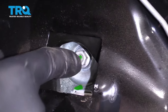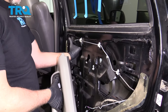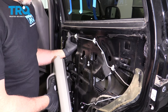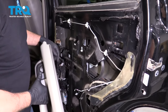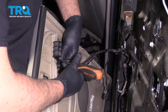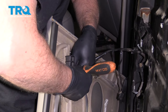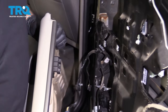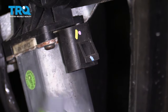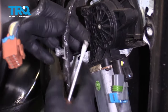That's broken free from the glass. Slowly hold the glass from coming down and put the window regulator down — you only have to slide it down a little bit. Turn the key off and disconnect the switch, setting it aside. Now disconnect this connector using a straight blade screwdriver, get the wires out of the way, and pull this retainer off.